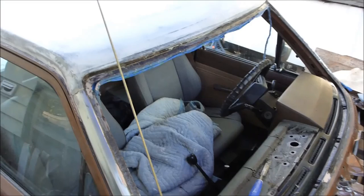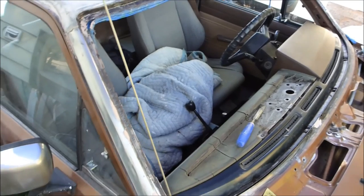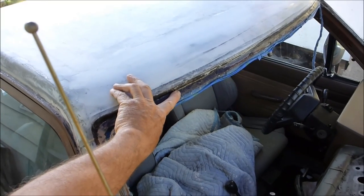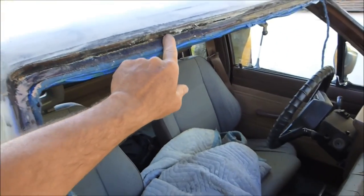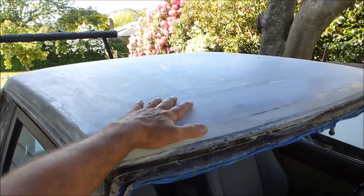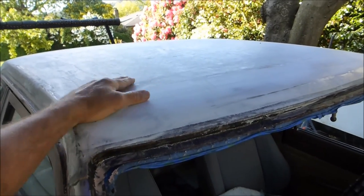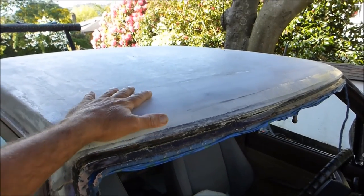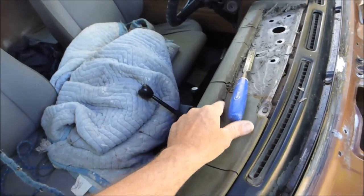It's been a while since I did a video — I kind of got into the body work. I wanted to solve an issue with water leaking down into the window and dripping inside the car, so I took the windshield out. I found a lot of rust holes that I repaired with fiberglass and bondo. There were a lot of dents up in the roof because these things are tissue-paper thin. I put five layers of fiberglass and a bunch of filler in there and I'm going to sand that smooth and give it a gel coat rather than paint, to protect it from salt.